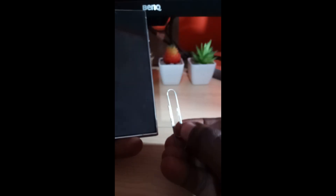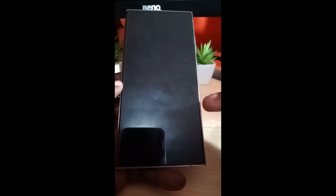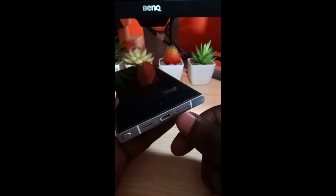You might be seeing 'no SIM detected' even though there is actually a SIM in the tray. It could be that you had an incident where you dropped your device. If you drop these devices, in most cases if they are not damaged and you have a good case, sometimes the SIM can shift inside the cradle and cause an issue.